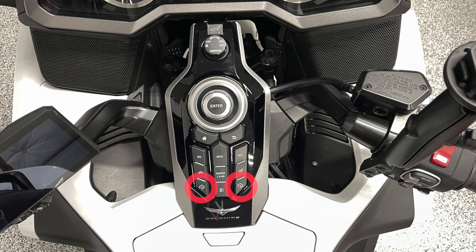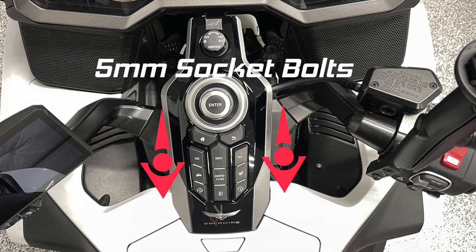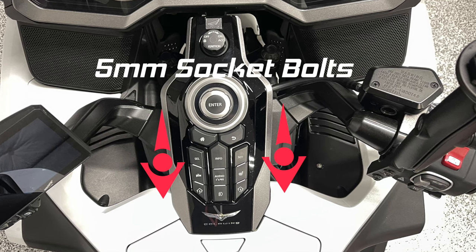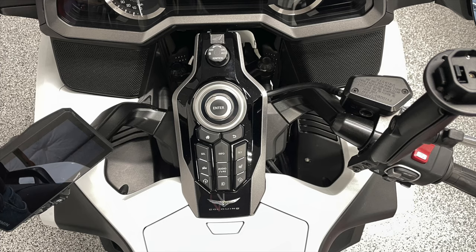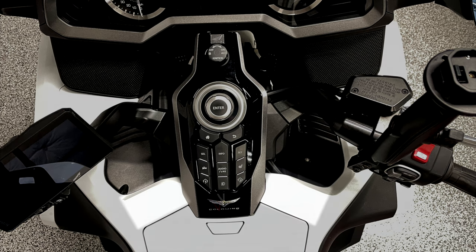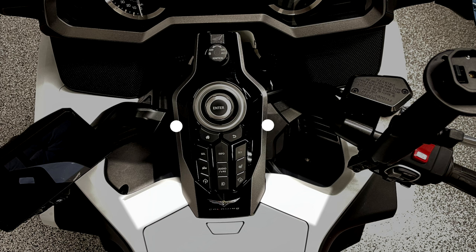Those Homelink buttons came in your kit. The center panel switch is held in place with two 5-millimeter socket bolts on each side. There are also two pushpin rivets in this area that we'll need to remove. While Honda recommends completely removing the center panel switch, which requires removing the top shelter and many other pieces, we're going to show you a shortcut today. What we're going to do is lift up these two pieces of plastic so that we can get access to those 5-millimeter socket bolts.